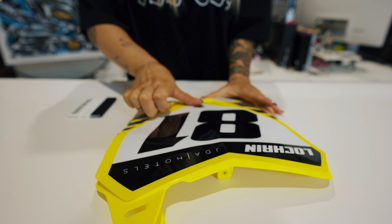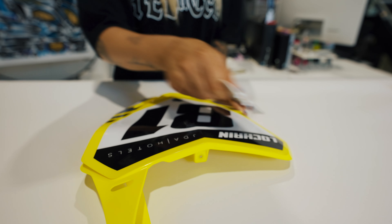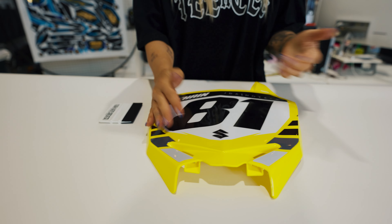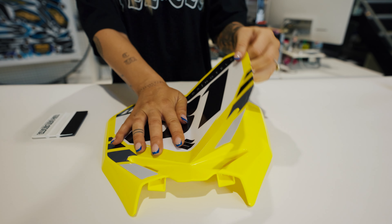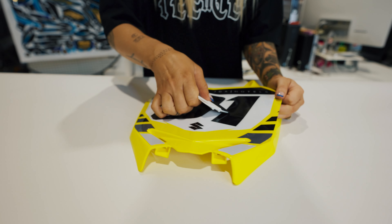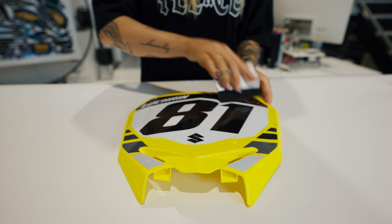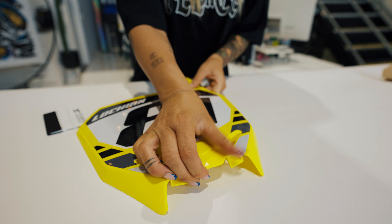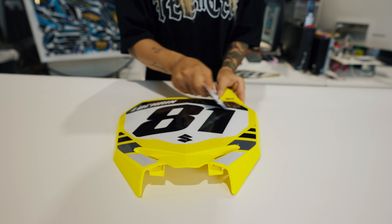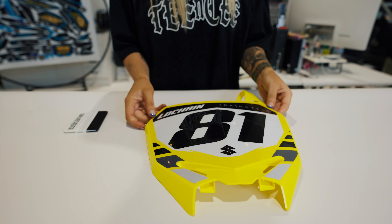It is really important to use your thumb for the center. That way it goes over any curved edges, and then you can grab your TNC squeegee and work your way outwards. If you do get a little bit funny with it, you can always peel the backing paper back — it won't lose the adhesive — and keep working your way down. Then just do one final roll over with the squeegee over all the areas. Make sure that all the areas are sealed down.